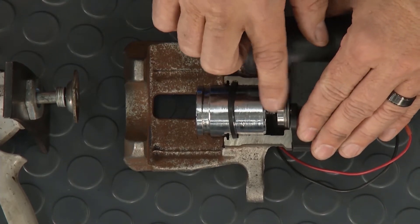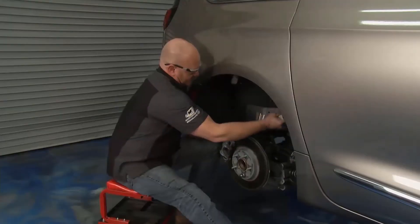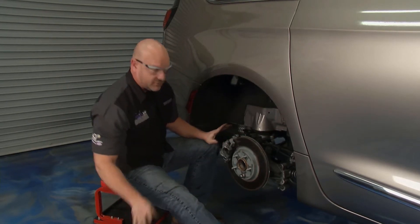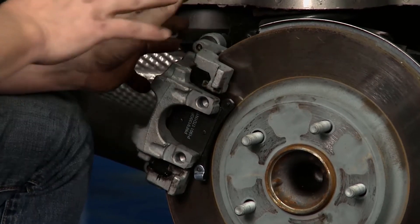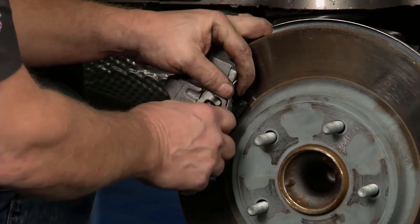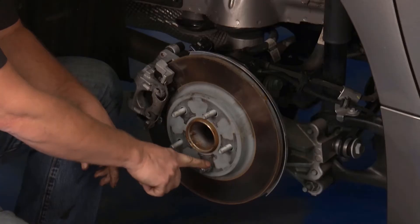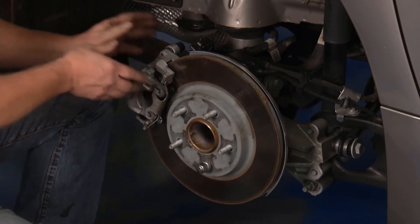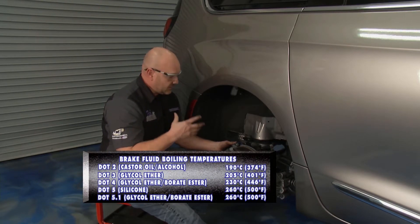Only at Tech Garage do you get to see the inside of the pistons. We're not going to go very far with our Pacifica until we check in with Brian and make sure he gets those brakes in tip-top shape. There is our final torque spec on the top caliper mounting bolt — we've already done the lower one, so we've got that all buttoned back up. We talked about retracting that piston in service mode — look how much play we've got in the caliper with the new pads in there. That's good evidence the piston is fully retracted. With this torqued back to spec, we just have to add the spring clip back. I like to use a lug nut here to keep that rotor true up to the face of the hub assembly. Reconnect the negative battery cable and get John to put this thing back in operation mode so we can take it out for a test drive.